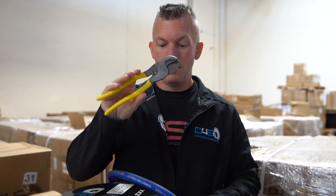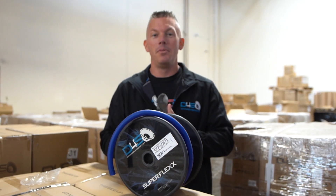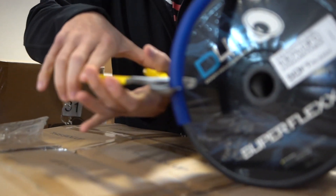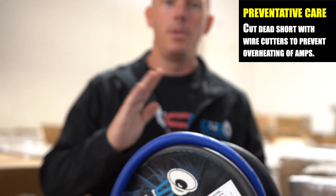You can do that if you have these $20 wire snips in your vehicle. Be sure to grab some and also grab a fire extinguisher — learn from other people's mistakes. You're driving down the road, you start smelling something, you find out your amplifier is burnt and going to dead short — what do you do? You jump out, grab your snips, roll up to that power wire, and just like that it's cut. That easy. You cut that connection going to your amplifier or battery, and you'll be good to go. You'll save your vehicle that quick. Otherwise, you're going to be sitting on the side of the road watching your vehicle burn to the ground. Wire snips and fire extinguishers should be a must-have in a car audio setting.